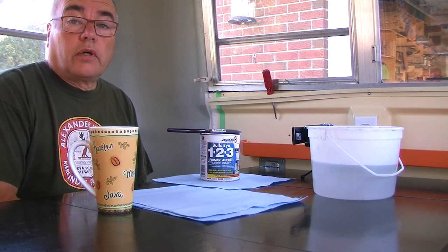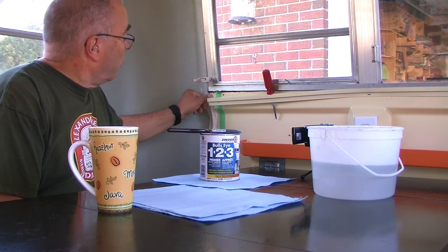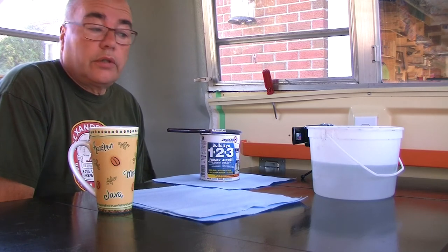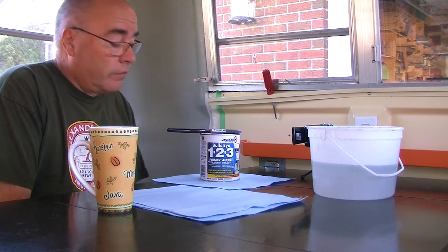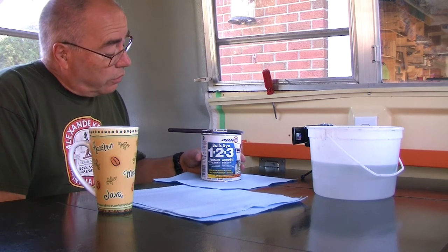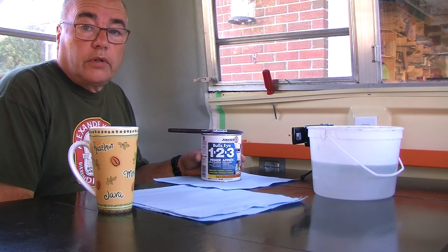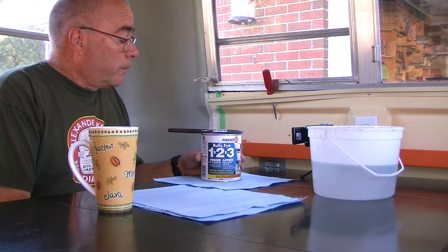Okay, so we've let our caulk dry overnight. And it's good and firm now. So next thing up on the agenda is to give it a coat of primer to help the paint stick. We like to use Zinsser Bullseye 123. It's a very good primer for all surfaces, and we found that it really helps the paint to stick and works everywhere we've tried to use it before.